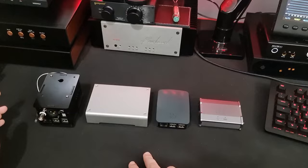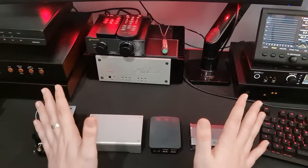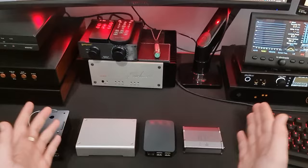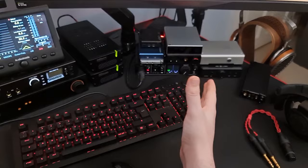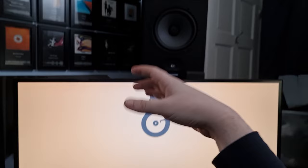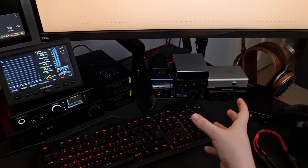So why does it matter? There are two other factors. The first is electrical noise. A beefy gaming PC is a horrible device to have in an audio chain — it's just about the worst possible thing you could introduce other than a fridge or a microwave. That electrical noise can have a negative impact on a DAC. At its worst, it can be just outright audible. My Motu M2, for example — I love that thing, it's feature-packed — but it has basically no noise filtering at all. If I'm playing a game with my monitors running on the Motu M2, I can just straight up hear GPU activity coming out of my speakers. The noise is being carried over the USB connection and passed through to the outputs.